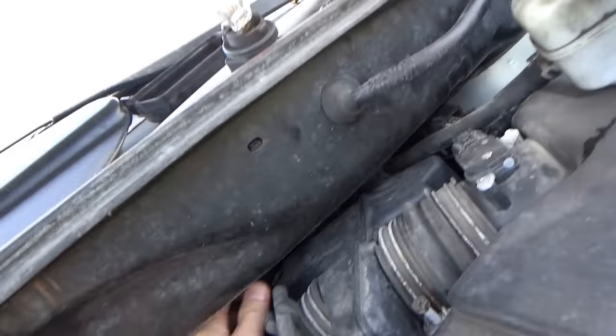This was, you really needed a process for this one. You have to be accurate. So, step one, determine, yes, we do have a short to ground on what circuit. Then, finding the short to ground took about as much time as the first step. And then, you do have to remove insulation from the harness, check for damage, remove the root cause of the problem, which was a really sharp self-tapping fastener. I don't know why someone would just go right into the fender, then install a fender liner, but quick and dirty, I guess, but that was the consequence there.